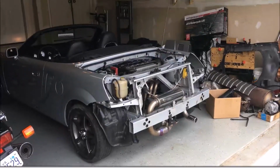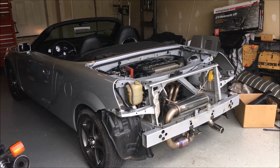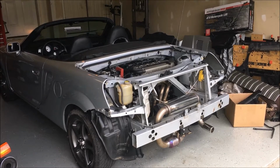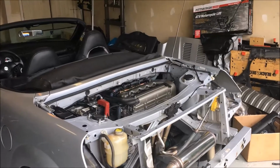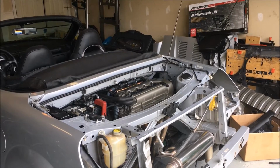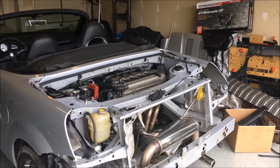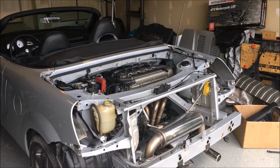All right, so I'm back. I took this thing for a little spin, brought it back, cleaned up the garage a little bit while I had a chance, and it was pulling a 301 code when I got back, although you really couldn't tell from the idle or anything what was going on. So I started again and pulled the plug. The plug was not gapped exactly right, it was a little close, so I spread it out, changed the coil packs around, that wasn't it. Reset the fuel injector again, which may have been a little loose, hard to say. So I got that in there, and now it's idling just fine.